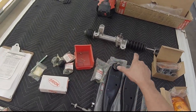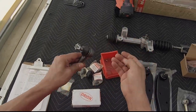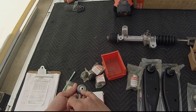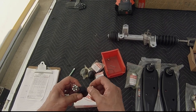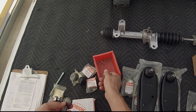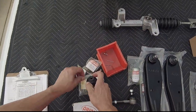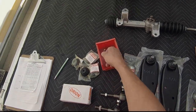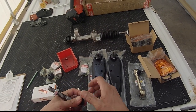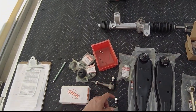I will have a list of these parts and their part numbers along with manufacturers in the description. What I like about these ball joints is that they come with Zerk fittings. So I can pack these, and when I do my maintenance, I can put more grease in them, just like most ball joints that you find in other vehicles. So there's that set, and they come with the cotter pins, castle nuts. Some of them you see with the nylon lock nuts, which I particularly don't like that style, with the cotter pin that'll lock it down.